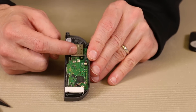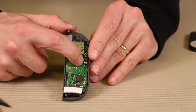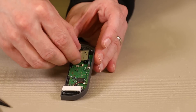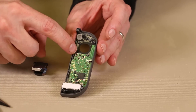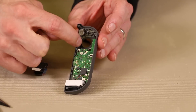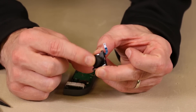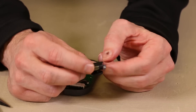And now it's time for the analog stick. It has two screws — one screw here, one screw here — both Phillips, along with the ribbon cable with the black locking tab right here. And there we have the analog stick. You have to be very careful — there is a black kind of film right here, and if you just jerk up on it, you're going to tear it, and we don't want that. So just be careful when you're removing this. If you ever have a problem with your analog sticks moving on their own or just not working correctly, this is the part that needs to be replaced, and as you can see, it's fairly simple to replace. These controllers are awesome because they are pretty modular and you can just replace certain sections if needed.